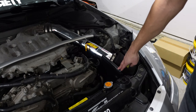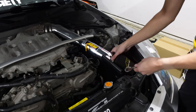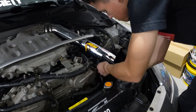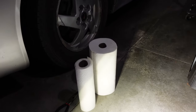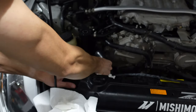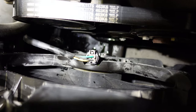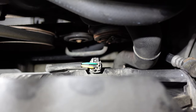For me, this heat shield is in the way so I'll have to remove it along with the air intake to get a little more space around this corner. Now I've got the intake off along with the heat shield. Next I'm going to jack up the Z and remove the radiator hose — I already put my drip pan down there and grabbed some extra paper towels for when the coolant spills out. There are two clips: one on the left side for the left fan and one on the right side for the right fan. You'll reuse both OEM clips for the Mishimoto fan.